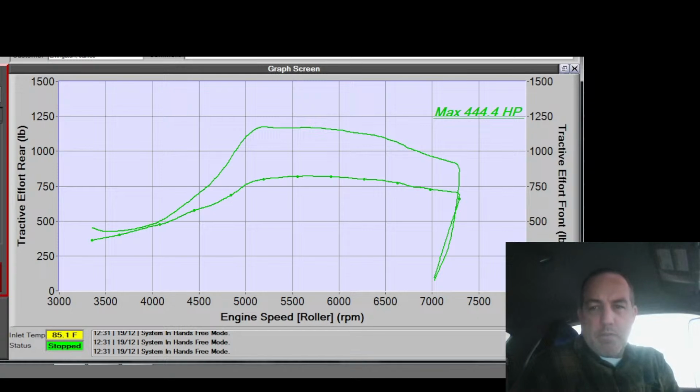Ignition, I mean. 18, 18, 19, 19, 19.5, 20.25, 21, 21.5, 22. Smooth that whole region, okay? Cam timing, 10, 10, 10, 10, 10, 10, 9, 9, 9, 9, 9, 9, 9, 9, 9, 8. 2 degree change to, oh. Didn't go back to 0.